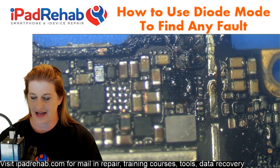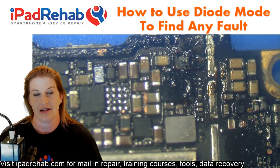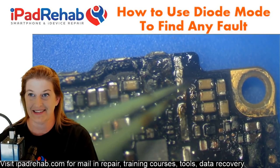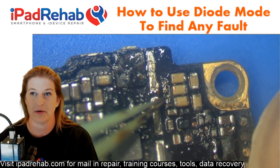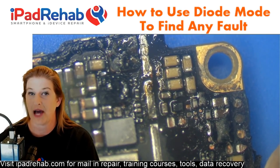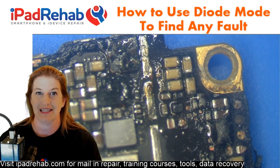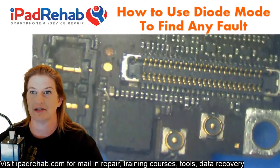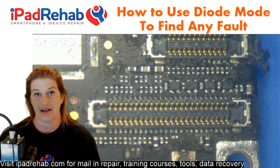The phone still has no image, and that's what brings us to diode mode. First I looked at the schematic to understand how image is produced — where image power and image data lines come from. I found image power lines out of chestnut. Despite the horrible corrosion around there, the caps are holding voltage and I get normal voltage. I replaced some corroded filters with wire to rule out variables, but I still have no image. Since image power is present but no image, that means somewhere on one of the many data lines there's likely a problem. Data is ones and zeros — that's hard to pick up a signal on. So we're going to use diode mode on the multimeter to figure out which image data line is at fault.